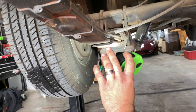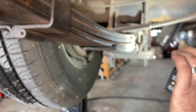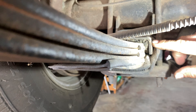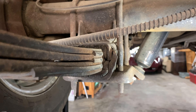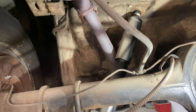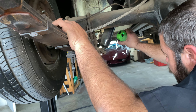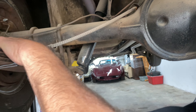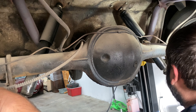Somebody's jammed rubber in it later because that's not the correct rubber. Also take a look at our isolators — absolutely shot. The shock bushings are shot; I'm sure if you unbolt those they'll go down and never come up again. Front bushings are also cocked. I would recommend springs, bushings, everything back here.